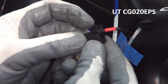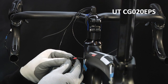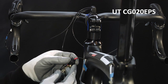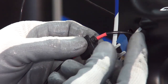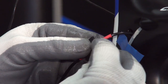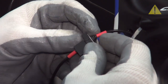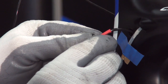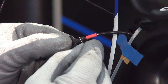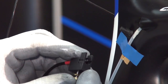Insert the connector with the arrows visible on the upper portion. Insert the fork between the connector and the tool and extract the male terminal by turning the fork. In order to extract the female terminal from the tool, press the lower pin.